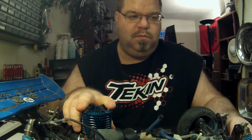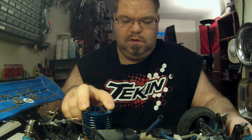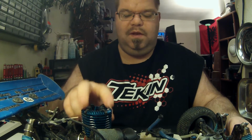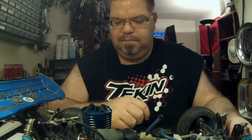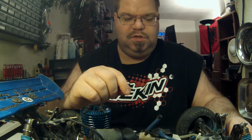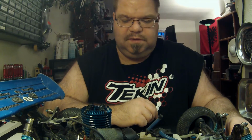So the only engine I had was the Mach 427, which I put the aftermarket blue head on, and basically modded the chassis and the engine. Well, the engine mount I didn't really have to mod. Basically what I had to do is mod the chassis. I had to cut a notch into the chassis for the bottom of the roto start plate to sit in, because it's stuck down just a couple millimeters lower than where the bottom of the chassis was. So I cut out a small piece in the chassis for that back plate to sit down in, and it mounted right up.